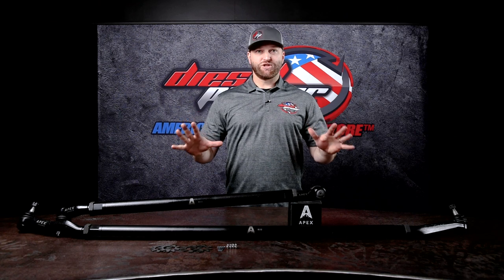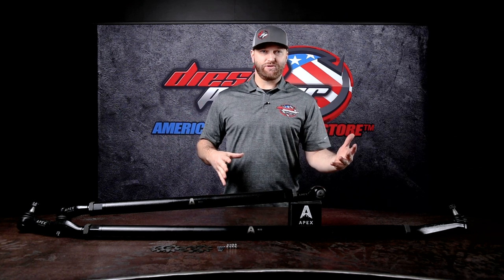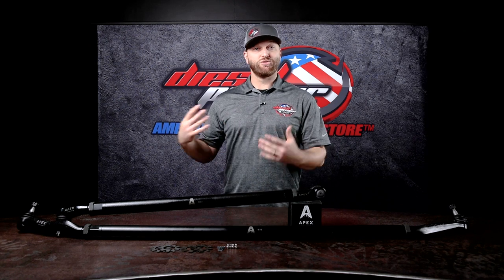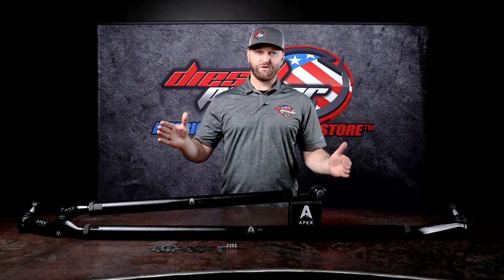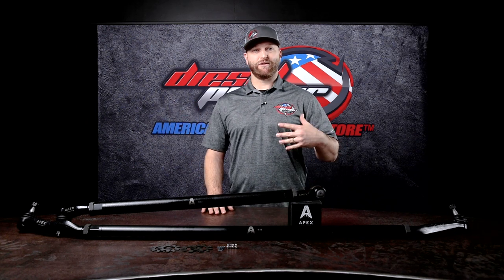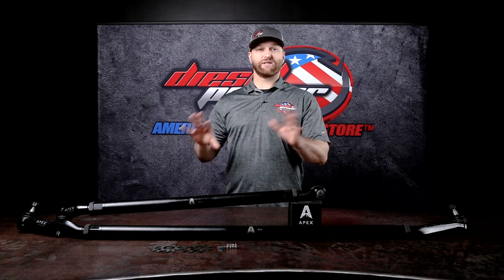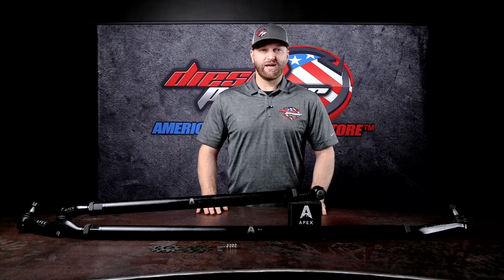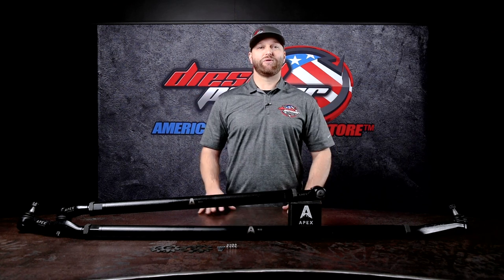Let's talk about applications first and foremost. This follows the same rule as the T-Style Steering goes, commonly known as the Mopar 09 steering, as far as fitment. So if you have an 03 to 08 Ram 2500 or 3500 that came factory with the Y-style steering, this will work as long as you use the updated style pitman arm. If you have the 09 to 2012 or 13, this will fit with the factory pitman arm.